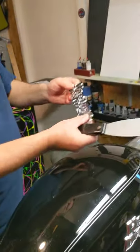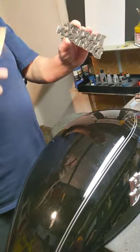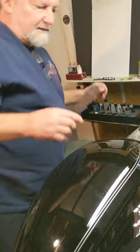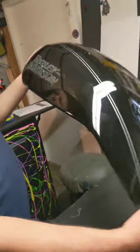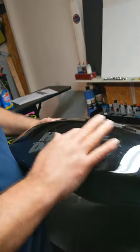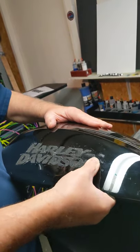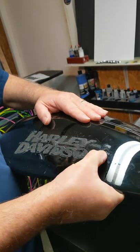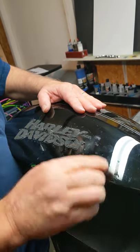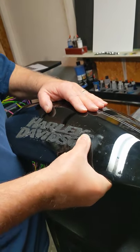Okay, here we have it — we have the emblem, still in good shape. You can see how the rubber was back there. We can buy aftermarket double-sided tape and do that exact same thing to put it back. You can see I didn't scar up the paint too bad — that'll be easily cleaned up. I'm going to use my thumb to get the rubber off, and when I'm done I'll use a little bit of solvent, just a tad bit of lacquer thinner, and wipe it down.